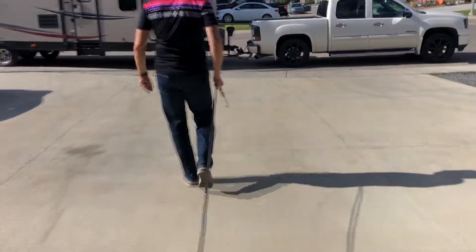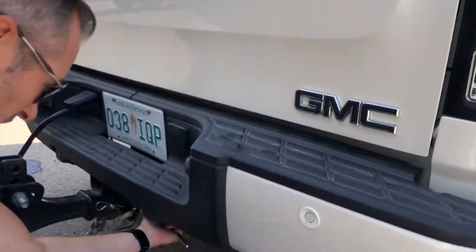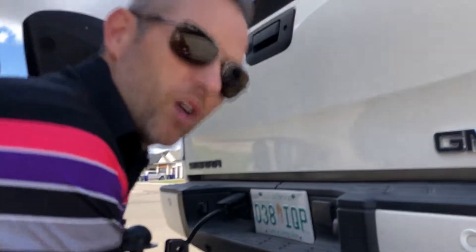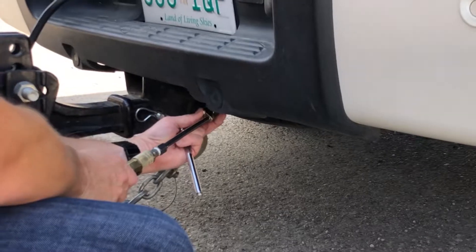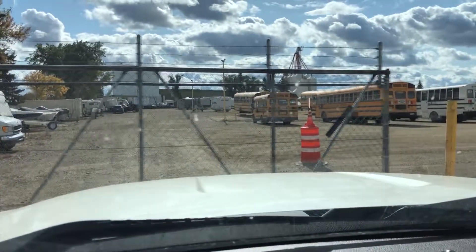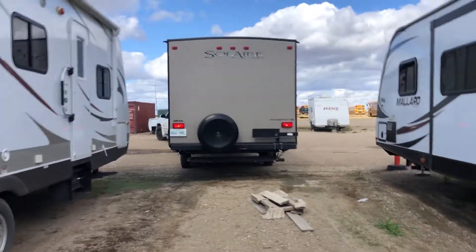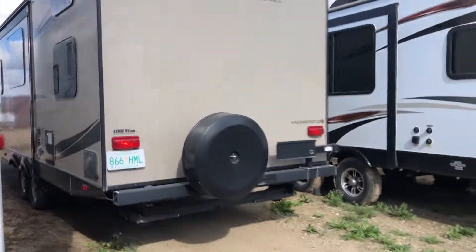Winterizing is done. Off camera I lubricated the seals on the slides. It is sagging a little bit in the back end because I forgot to put air in the airbags on my way over, so we're just going to top that up. I installed an air ride system with a manual fill in the back — for the next truck I will have an onboard compressor. We want about 70 to 80 pounds. That concludes today's video. If you have any questions or I glazed over any details, please let me know in the comments. Please subscribe and hit that like button!